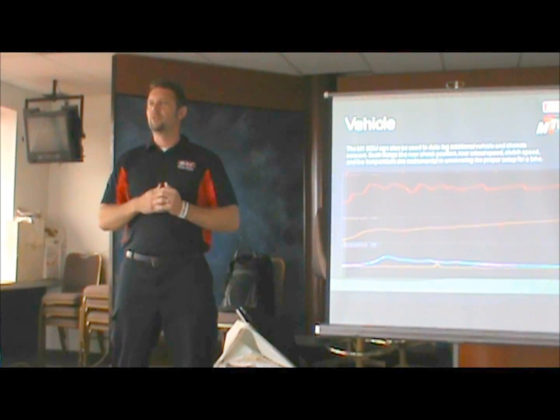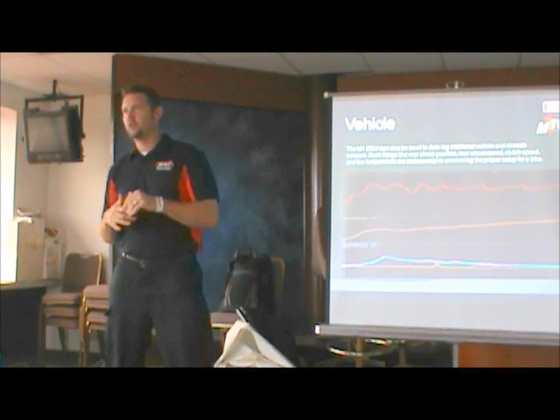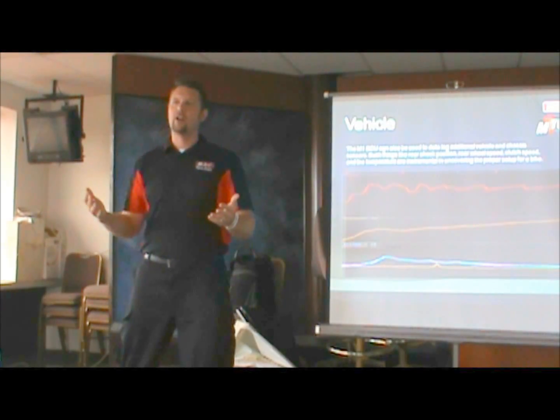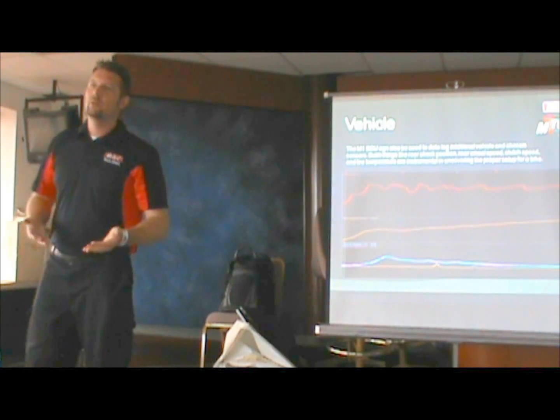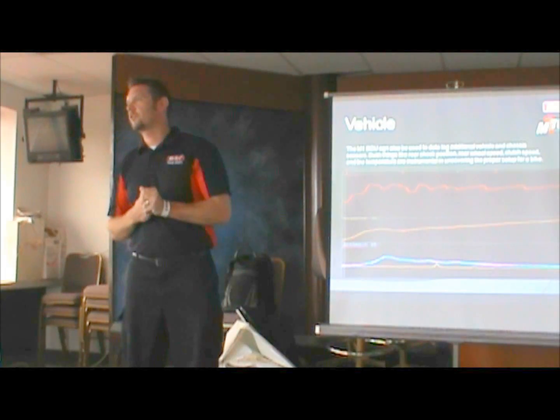One of the things on big tire bikes, or even what we've done before, is if you have enough spaces, you put 3 of them across the tire. You can actually find that a lot of riders just naturally will lean to one side, and they'll only heat up one side of the tire. Or if you put one on either side, you see the guys that are trying to heat up the outside of the tire, but they only do it very well on one side. So you don't have even temperature distribution across the tire when you try to launch.